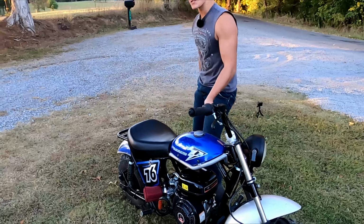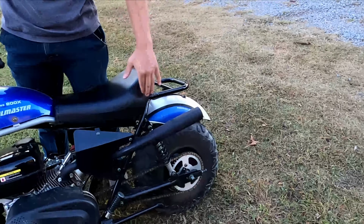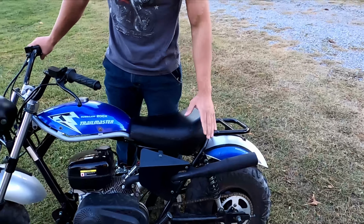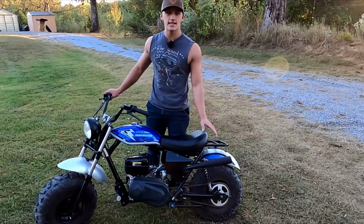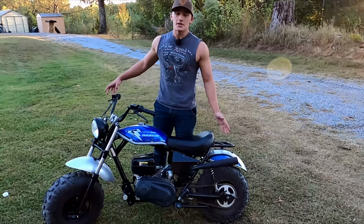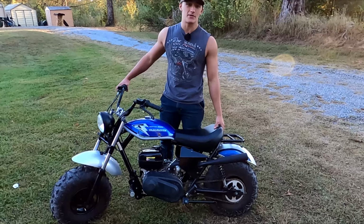If you're going to be putting an exhaust on one of these, you have to at least have the stage one kit. It is not good for these motors at all to put on just the exhaust without the stage one kit. It's going to lean out these motors too much and you're probably going to hurt them quite a bit. Of course, I'm sure doing burnouts for that long probably isn't that good for them either.